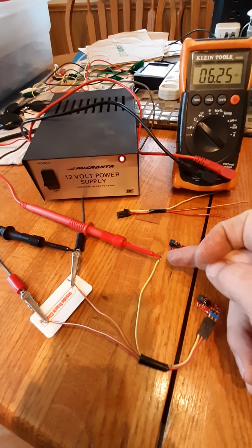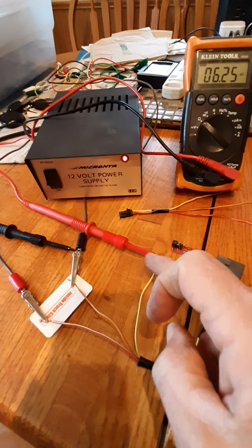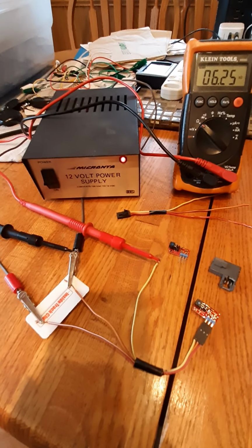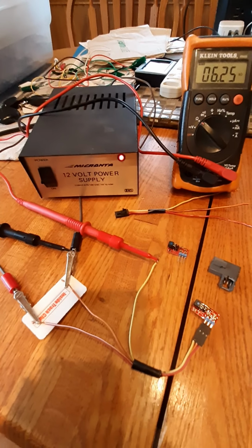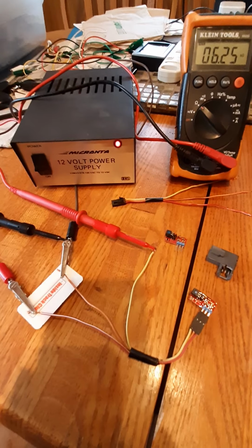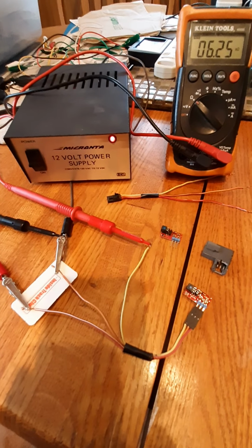The different resistances will drop that 5 volts, being that it's a resistance between the 5 volts and ground, drop it to a different level. The BCM expects a given level for that truck. If it doesn't see the right level, you get a security light and you don't start.